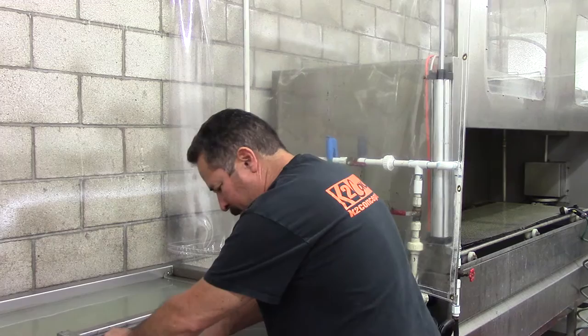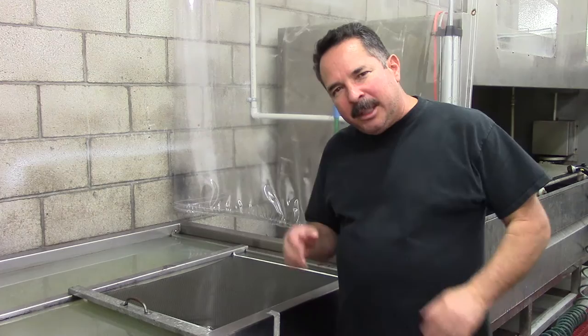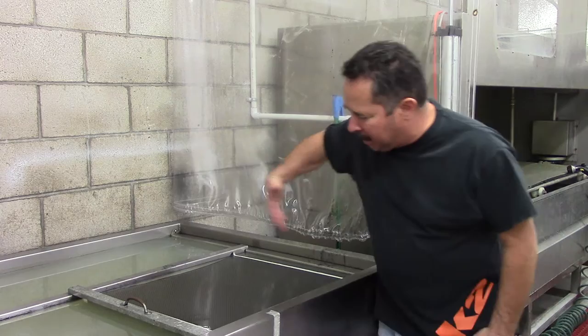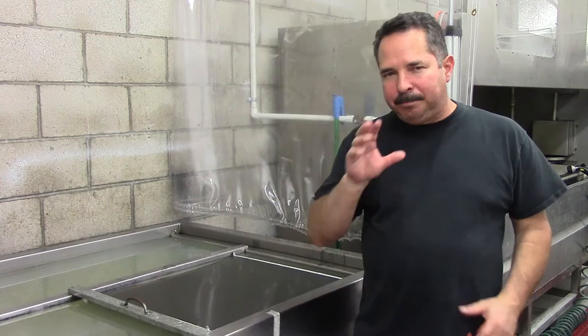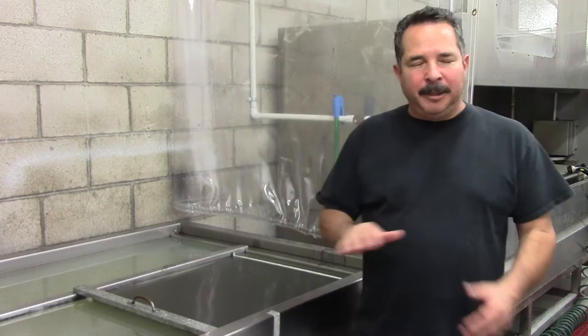We're going to have a little bit of tough time keeping pattern on today. I'm going to turn the fan real quick. We're also going to demonstrate a tic-tac-toe pattern, so you're going to see me come in this way, this way, and then this way, and this way. A lot of guys have questions about what a tic-tac-toe pattern means — it's just that. Like if you're painting a car door, you guys that are car painters will understand the method and what we're trying to accomplish here. You're just trying to lay down an even layer of activator. Let me put on some gloves and we're ready to go.